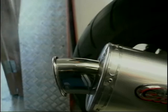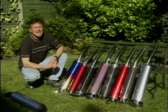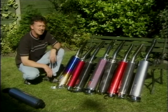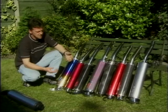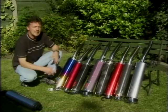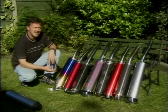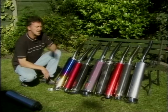So what has all of that achieved? Well, it's achieved a very large headache for the cameraman, because it's extremely noisy in a dyno room, believe me. But the results really were as we suspected. Whilst all of these have improved the performance over the standard can, it's very, very difficult to split them — they're all very, very close. And if you covered up all the badges and went out on the bike, you'd never know which can you had on. They're all easy to fit — you don't need any special tools. Some go on slightly better than others, some of the clamps are better, but they all go on after a bit of fiddling about. Just a couple of spanners and an Allen bolt — they'll only go on one way, you can't get it wrong. So we've got polished ones, carbon ones, colour matched ones, fancy textured ones, and a fancy Blue Flame one with some tricky colours. Really, at the end of the day, it's whatever you like the look of, whatever you want to spend your money on to make your bike look nice — that's the one you need to buy. Because performance wise, you're not going to know the difference.